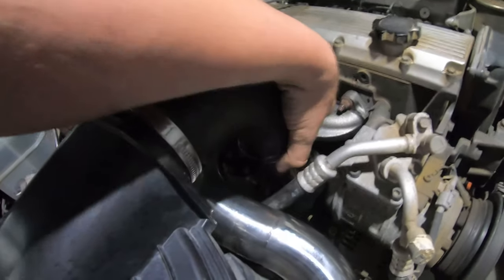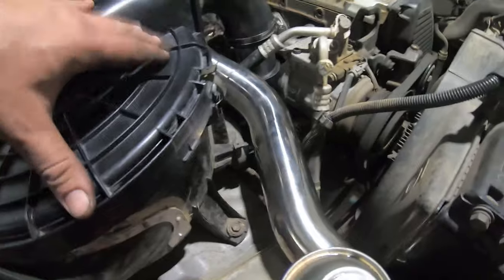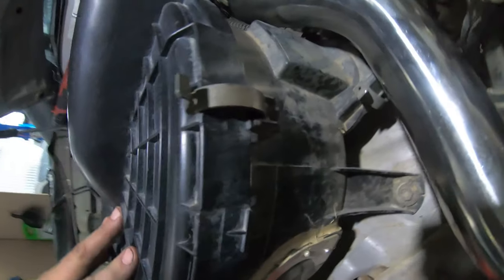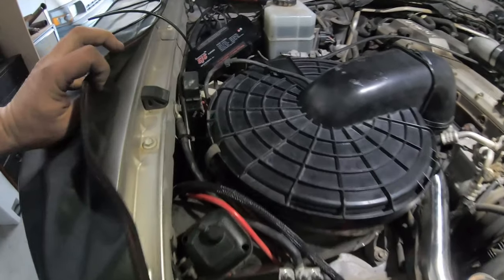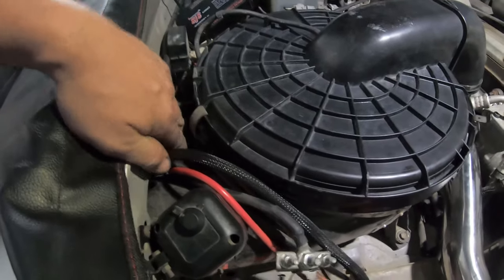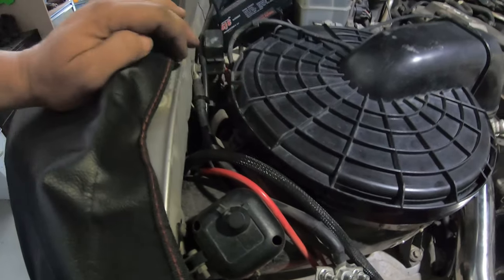The final piece to the puzzle was the intake of the turbo to the airbox. The problem is there's a spot for the clip and the lid can rotate into position where it's holding — you can see the two locators — except the problem is when this clip goes on it's loose with no pressure. So if this car goes in water the snorkel's not going to be doing its job and water can get in. I rang G Turbo for their workaround — they had a chat to their fitters and the workaround is to bend this clip up so it crimps it down and gives more pressure there. I'll give that a go and see how it goes.